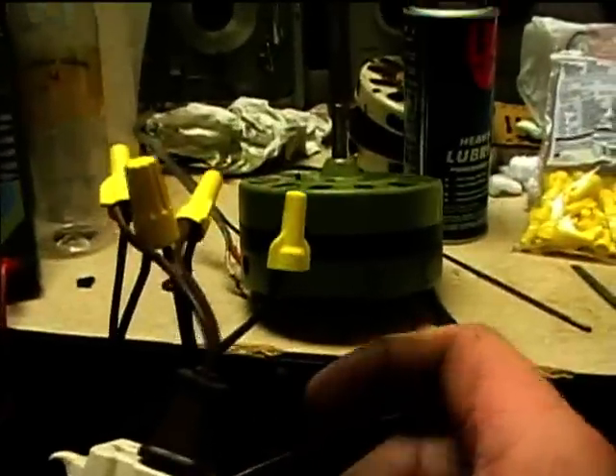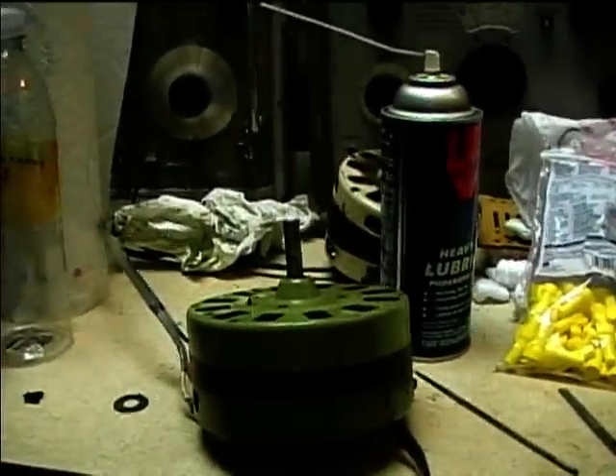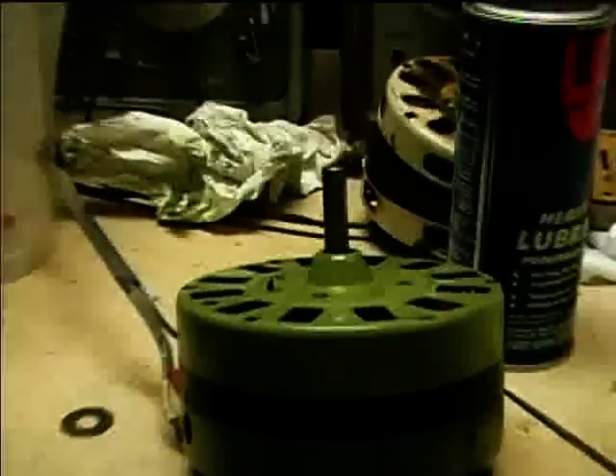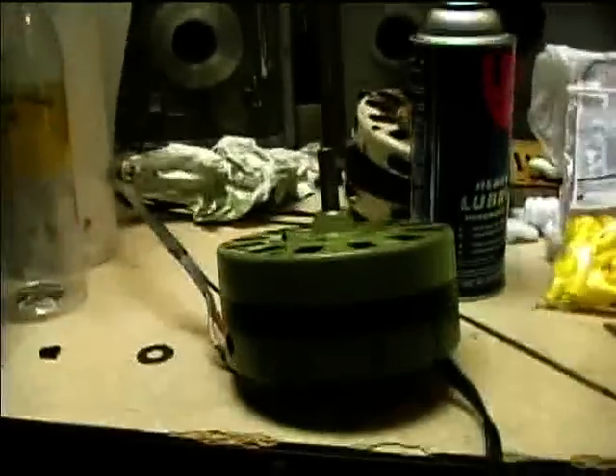I'm going to try it with the short check lamp. I've got it wired up with this lamp in series, so in case there's a short, nothing will get damaged. I'm going to plug it in. There's a little bit of noise, but it is running. It may be at the front bearing that the noise is coming from. Here's the test lamp — you can see the lamp is glowing dimly, which indicates it's not drawing too much current.